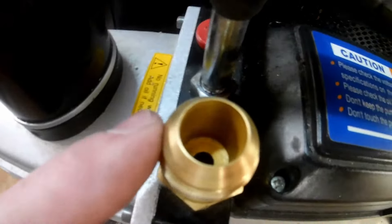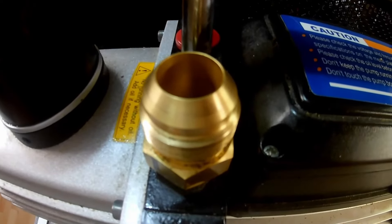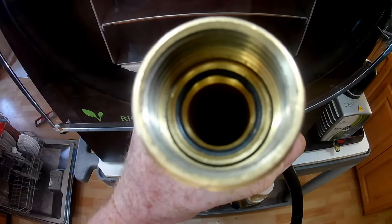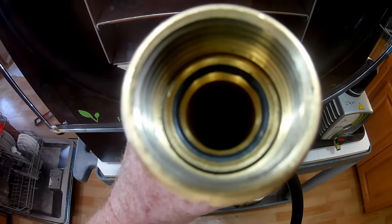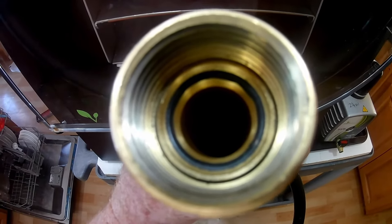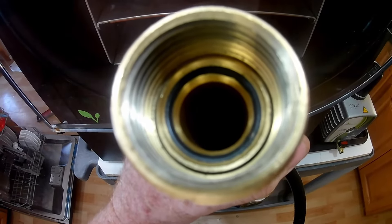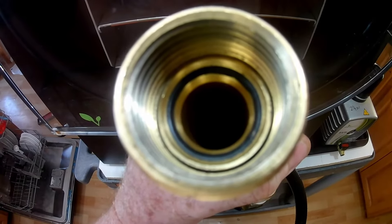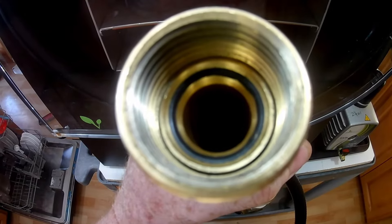If the face gets damaged here or here, you're going to have a problem with vacuum leaks. The female side of the JIC fitting is also flared. Harvest Right - and I wouldn't want to call this proprietary - but they have a little o-ring in their flare fitting. I have looked everywhere but I cannot find a flare fitting like this that has an o-ring, so I don't know where Harvest Right gets them. It's pretty much proprietary.